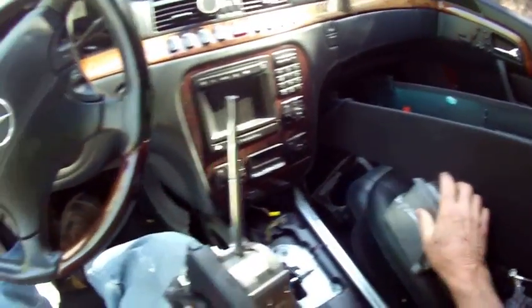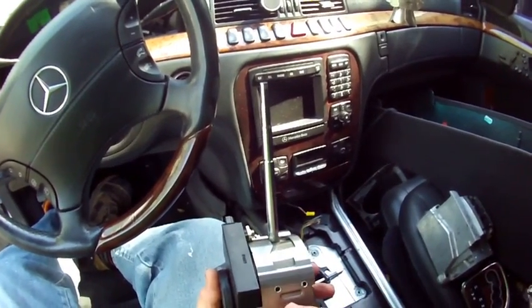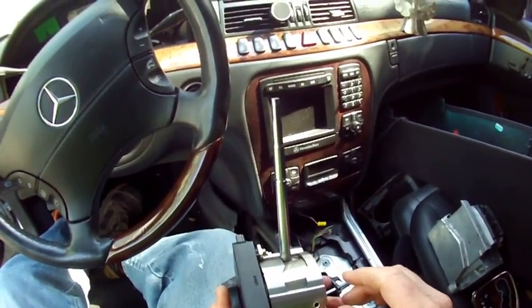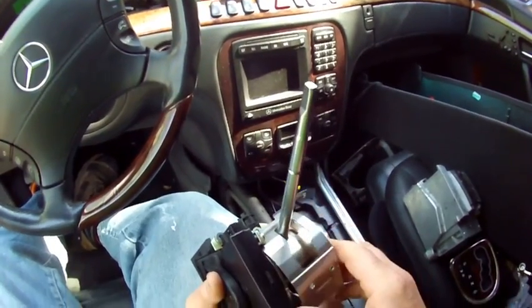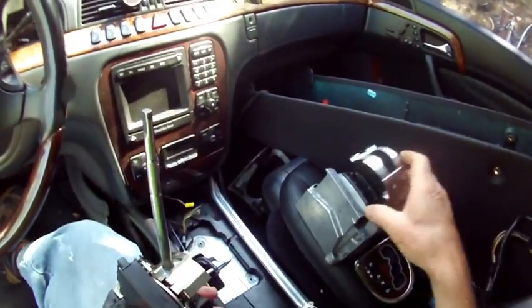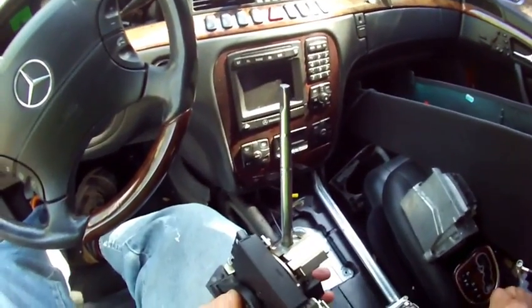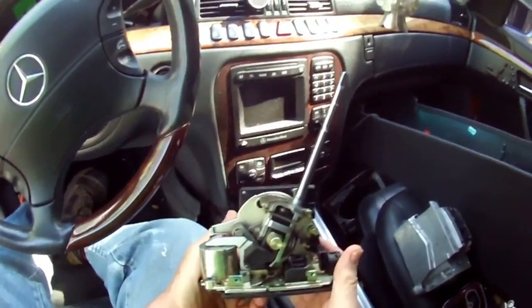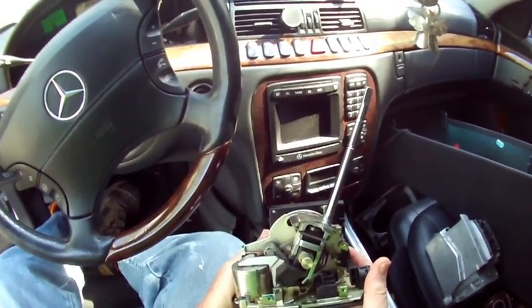Once you've got this out in hand, there are several screws on the bottom that hold the outer shell to the inner guts, plus screws holding a plastic plate on. About three screws held that on. You've got another inner shield in here - I think there were rivets, but these were gone by the time I got to it. Somebody's clearly been in this before. Take out the tiny three-and-a-half millimeter machine screws holding that on, remove it, and that reveals the guts - the working scenario of the shifter.